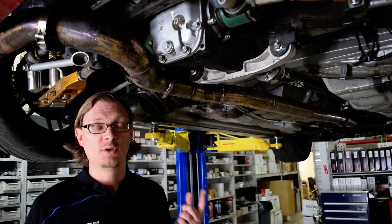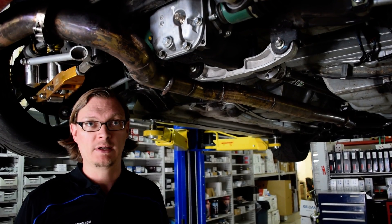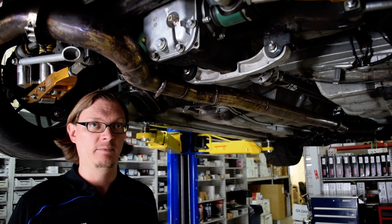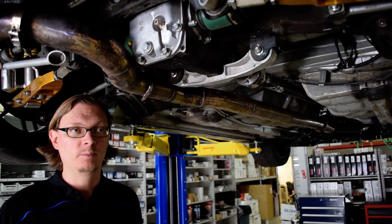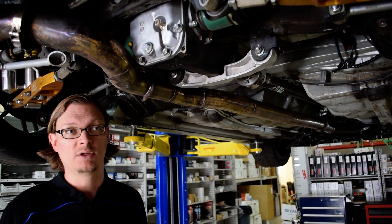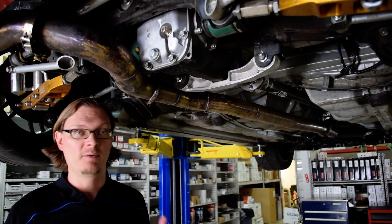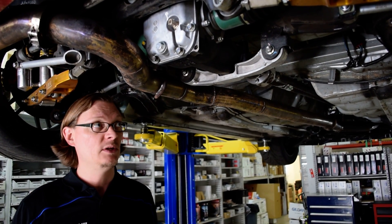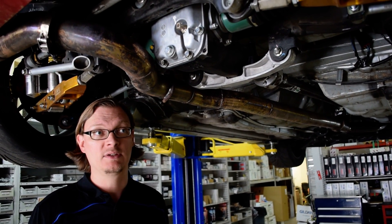Now we'll come to the back and talk about the rear diff. As I mentioned at the beginning, the newer WRXs are a little bit tricky, and the main reason for that is the final drive ratio of the rear diff. All the STIs in the U.S. are 3.9 final drive, but some have a different transfer ratio. Starting in 2006, the transfer ratio on the STI changed to 1.1:1, so the rear ring and pinion ratio of the rear diff is not 3.9 — it's 3.545:1. The WRX, starting in 2008, has a 3.9 rear ring and pinion ratio, so you could not bolt a newer STI transmission in with the stock WRX rear diff.